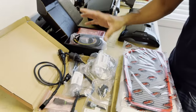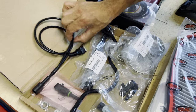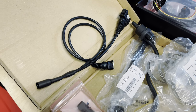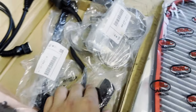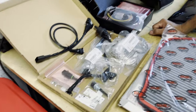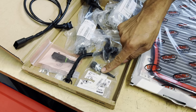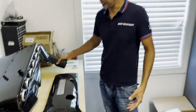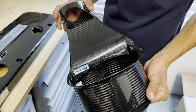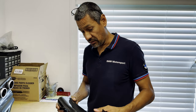We have all of the clamps, though knowing I work on BMWs a lot, I do not have this particular clamp, so we'll figure that out. We have the pigtail here — the Turner Motorsport IAT relocation, which makes the IAT install a lot easier rather than making up your own. We're going to use the Turner one because it's quicker to install. We also have two IAT sensors — one Euro and one American Spec. We'll go with American Spec. When you look at something this beautiful, it really, really hurts to drill a hole in any of this — I will shed a tear, but it is for the greater good.